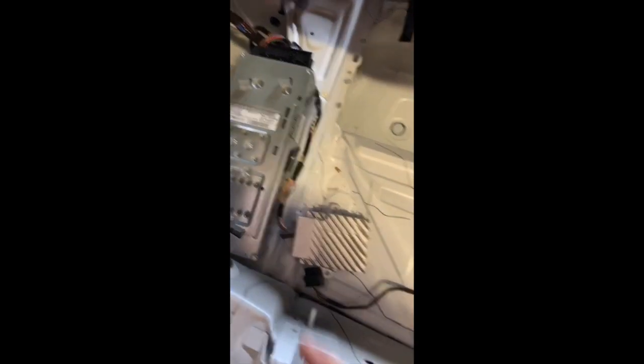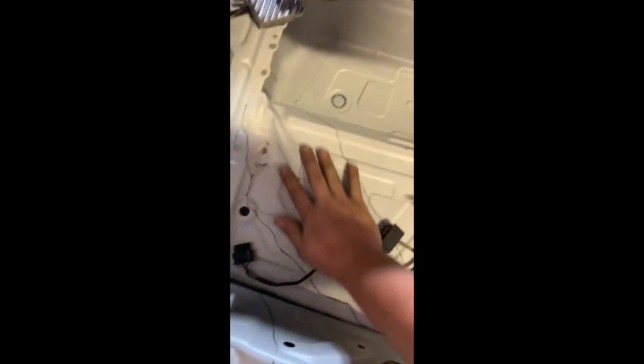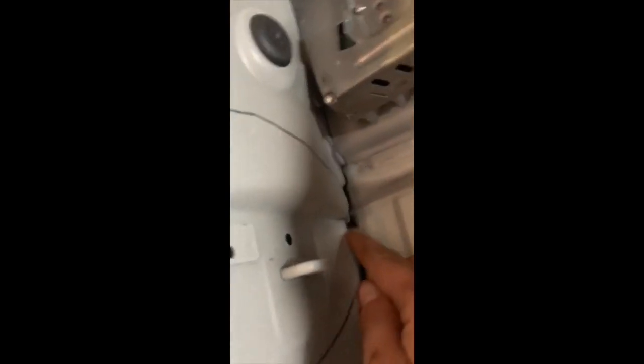All this right here — we'll see once I start pulling if I'll have to replace the quarter or not. They made marks where it crumbled, so basically this whole tub needs to be replaced. That little skin is so torn up. On the inside right here this can probably be straightened out, but that bottom piece has to be replaced. See how it's crumbled — that means this whole structure is pushed in, so I've got to pull it.